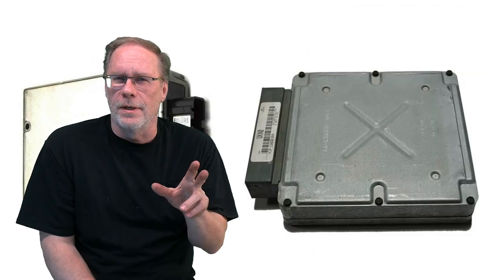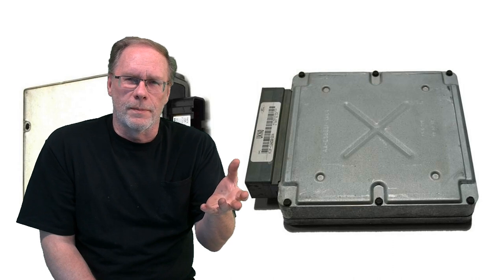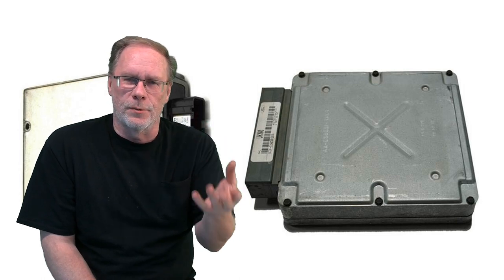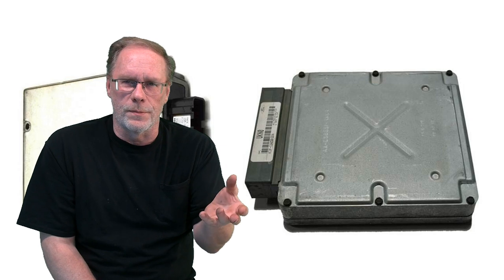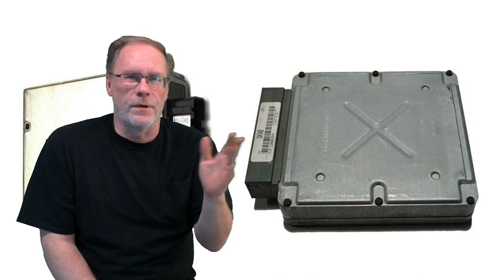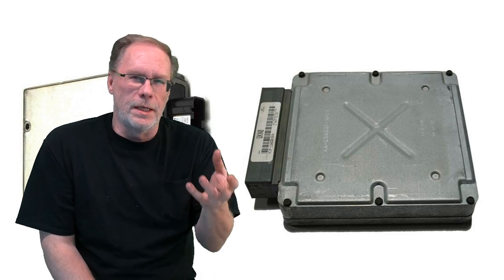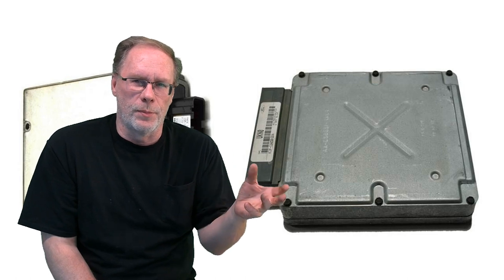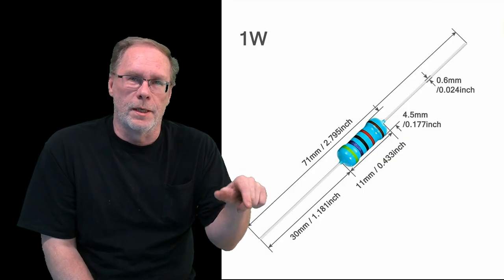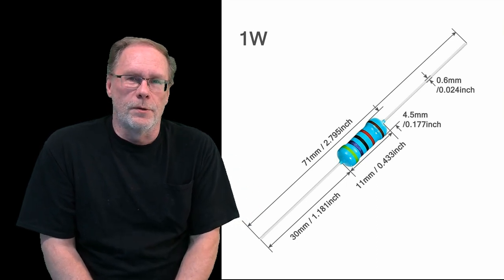Now, it's very important that whether you're disconnecting exhaust back pressure or disconnecting this right here, the computer has to realize a certain amount of ohms. The computer runs somewhere around that 456 ohm, 470 ohm area. With this delete, you're still going to have to tell the computer that things are copacetic. In the listing below in the description is going to be a website for Mouser Electronics.